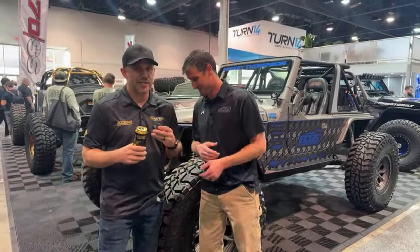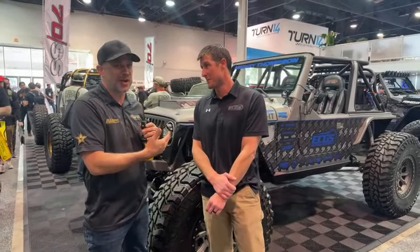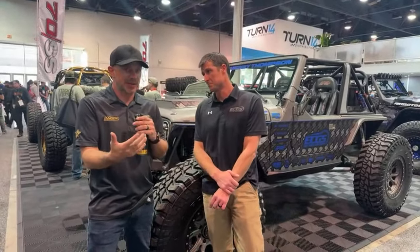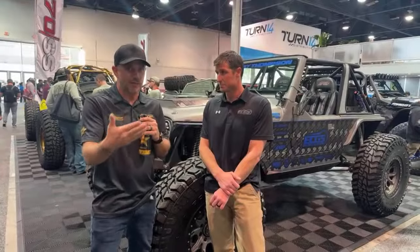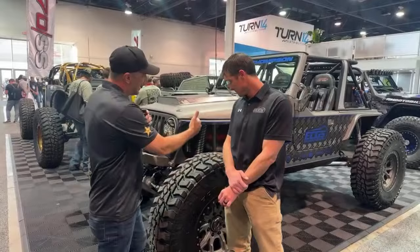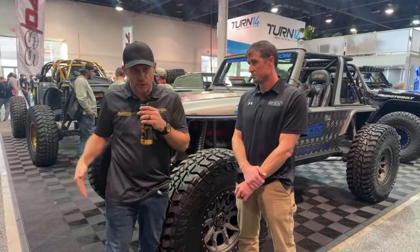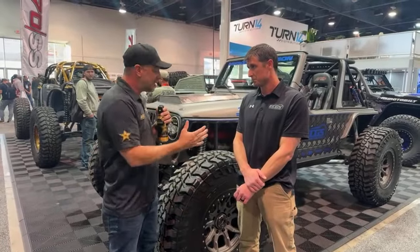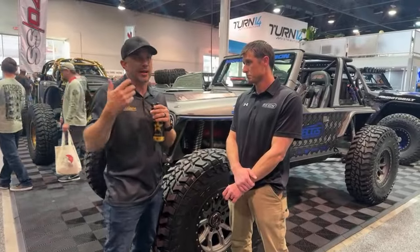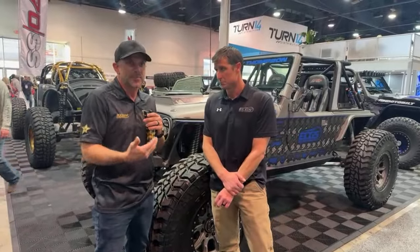So to touch on what he's talking about, he has a good way of talking about it. When he's talking about his Kingpin redesign and the scrub radius, the way to explain that is if you've ever been off-roading and you watch yourself or your friend with a big tire turning, and that tire is getting into their frame, their stuff, or the front of their bumper, that's the overall scrub radius on the tire itself. So what he's doing is sucking that in so that it makes a cleaner, tighter scrub radius, like a Baja race truck would, so that you're not getting into the body or the suspension, and that's a good thing to do.